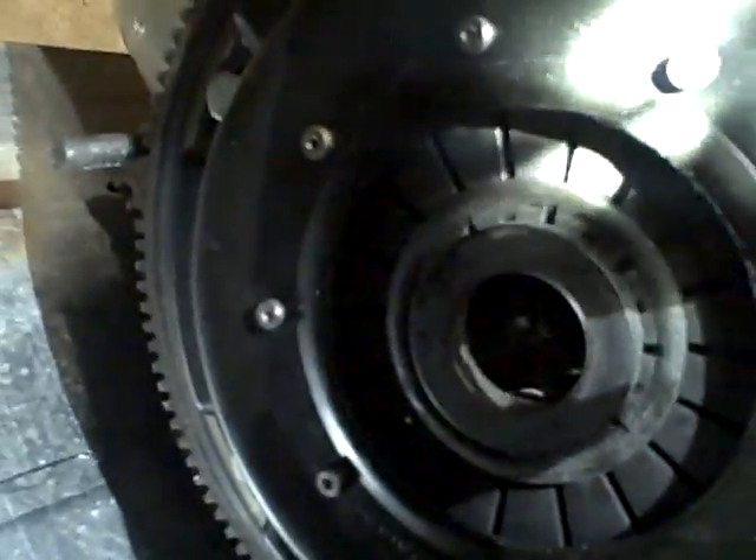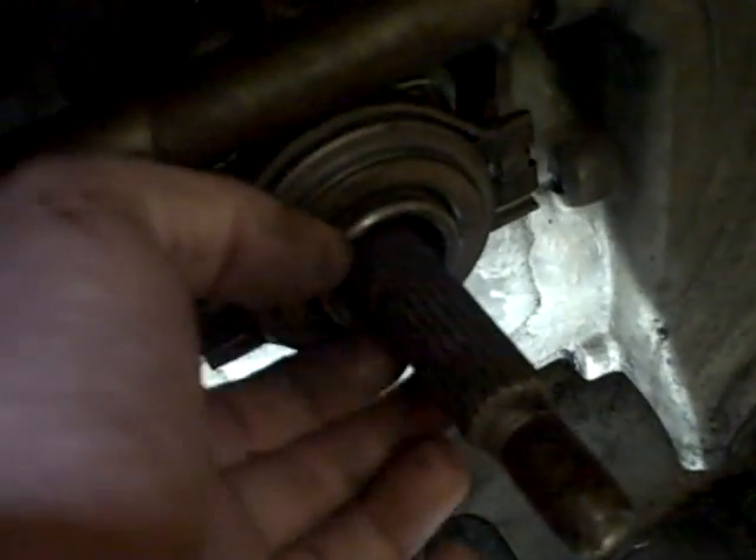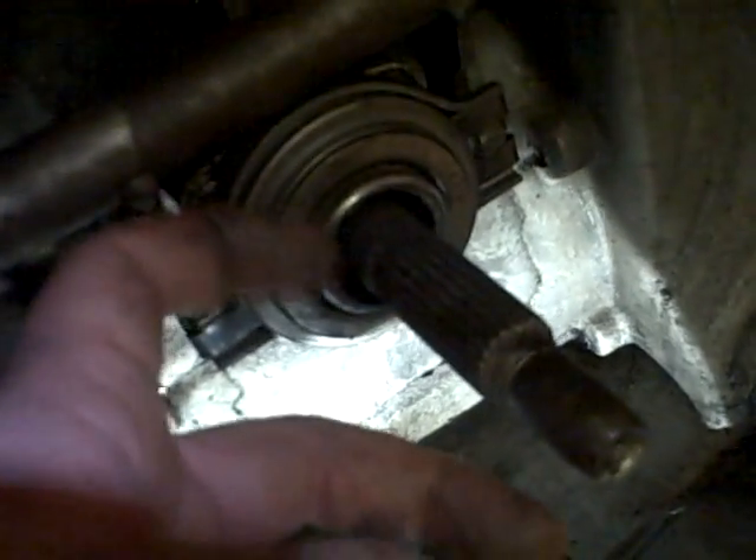When you don't remove the ring from your late model pressure plate, it has a possibility of doing this to the throwout bearing. The throwout bearing appears to be fine, but you can see that the thrust bearing will not come past this little mushroomed leading edge where it pushed up the metal on that tube, which I think is replaceable on an early model.